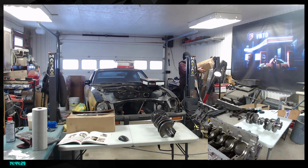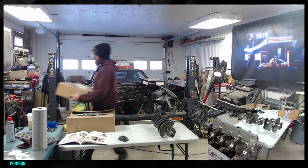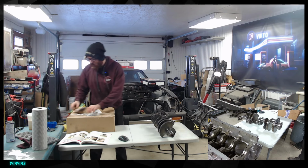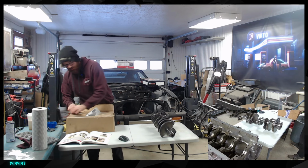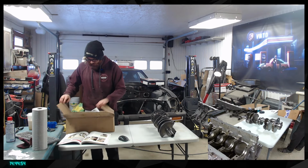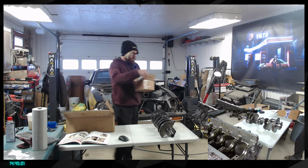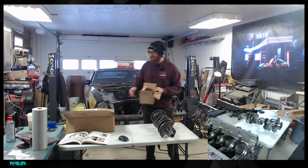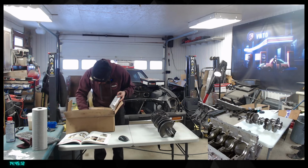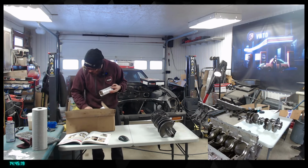One thing to keep in mind is that I had the engine balanced with a new set of pistons. They are some used pistons, actually. I went a bit cheap on that. It's not the proudest move of the build, but still I had a deal for some pistons from an LS3, which is a Gen 4 and pretty much the same thing that I used so far. That's why. All right, so here they gave me back all the rings, but since I'm replacing them, we're not going to use that. Here is probably for the flex plate, which we are not using. Yeah, flex plate to crank, so we're not using that anymore.